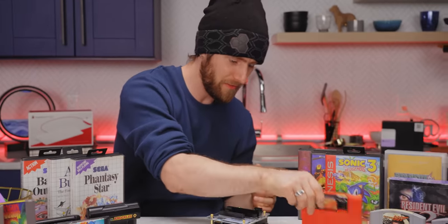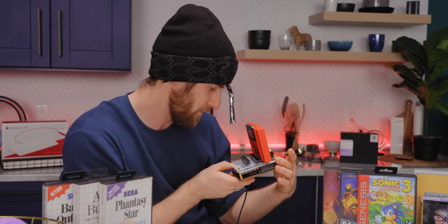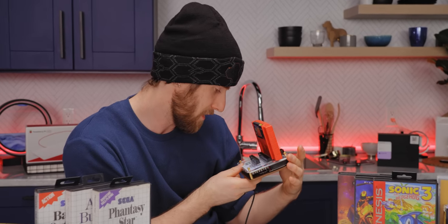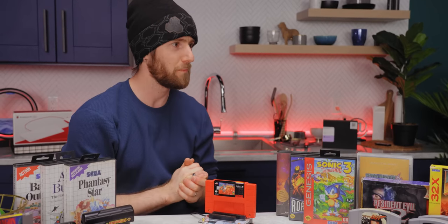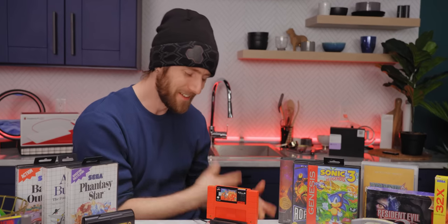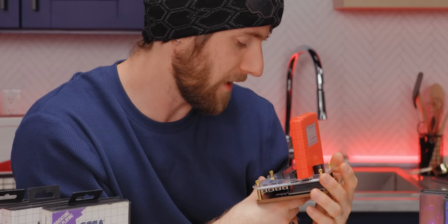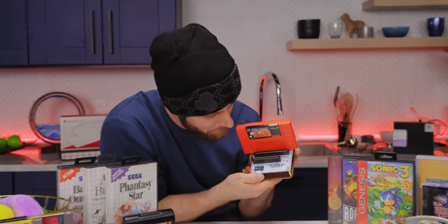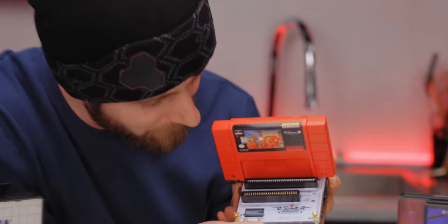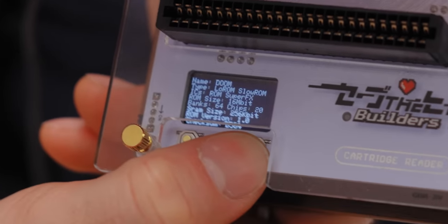So you pull this off and hit Read ROM. You'll probably want to hit Cycle Cart first, then Read ROM. It keeps a tally — it creates a new numbered folder each time, so you can rename it on the computer afterward. If it calculates the checksum and something's wrong, it'll say checksum error. So let's do the cycle cartridge thing first. You're going to want to be careful — this is the kind of thing where you read the manual. NES games go into the SNES slot with the help of a handy adapter.